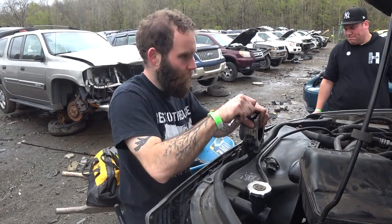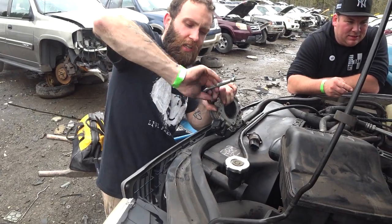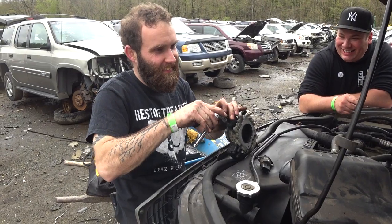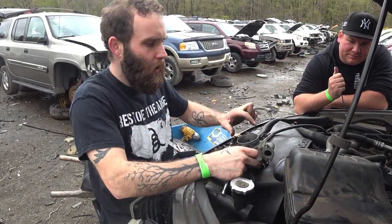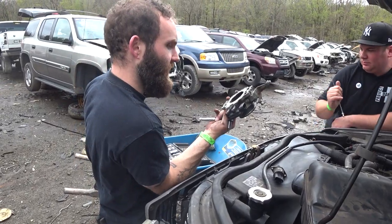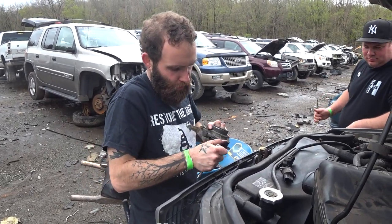This one is really loctited in there. They also happen to 4.7 liters — been there, done that. I actually keep one of each of these in my glove box in my four liter, cause I can't tell you how many times going through a big puddle the transmission doesn't shift. Sometimes you can just get the water out of the connection but most times they short out. That's the guy — it slips right over this little doohickey and then you jimmy jam. When you put a new one on, make sure you can still open your throttle plate. He's losing horsepower there. I'm gonna pull one more and then we can move on — Dan has a much more worthy project to be working on.